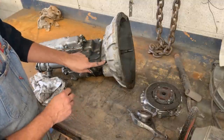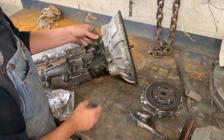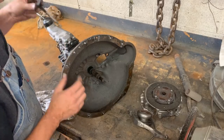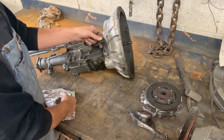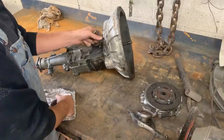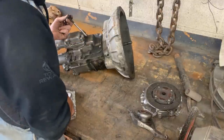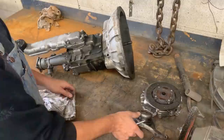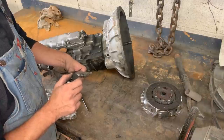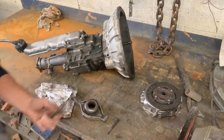What we're gonna do, this hole, like we said, this hole is wider at the top, but it tapers underneath, so we're gonna drill it with this size. We're gonna drill the bottom hole with this size, and then I just want them to be concentric, you know, and then we're gonna drill this one wider, and we're gonna make a sleeve for there on the lathe to bring it back to this size all the way, not only the tapered part. And then for here we're gonna do the same thing. Like, we're gonna drill it out just a bit, and we're gonna make a small sleeve to fit inside. So that's it. Let's find a drill bit with this size.